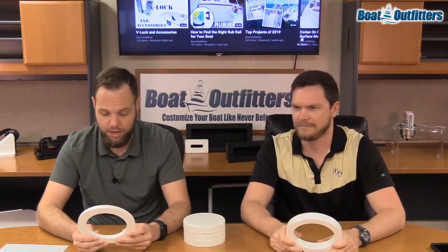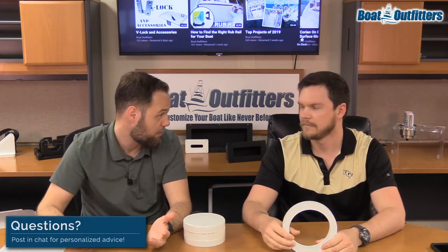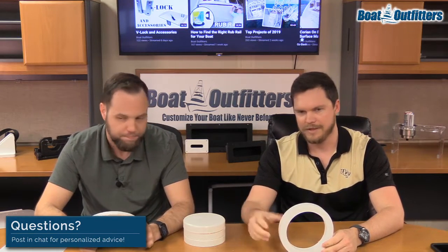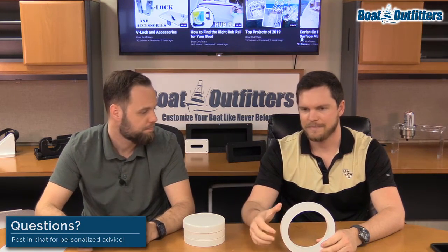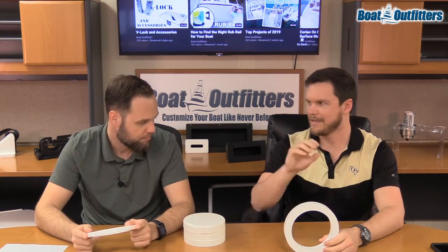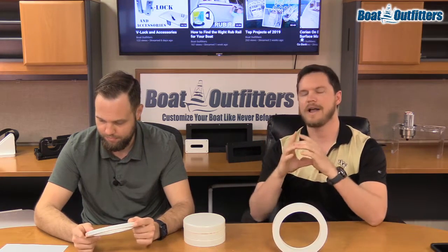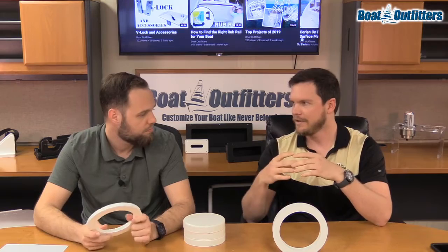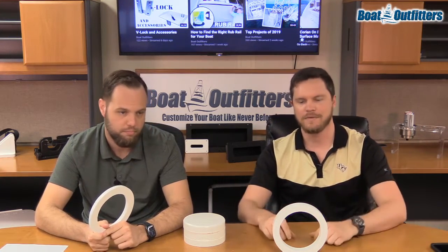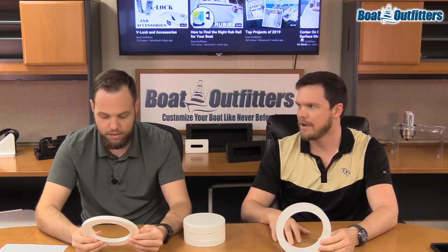And we say speakers, and of course, most speakers are circles, but we do a lot of these for radio trim plates as well, right? Absolutely. What are some of the last couple projects you've done? Yeah, you run into it a lot with switching out VHFs, or switching from a double DIN radio to a single DIN, or maybe you're going to one of the round, Bluetooth-supported, gauge-style radios, and you had a long rectangular one before. You can get a plate with the cutout in the middle that will match the diameter of the radio that you're mounting in there.